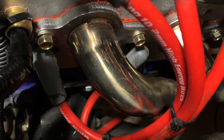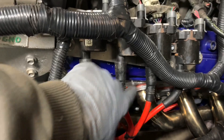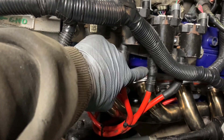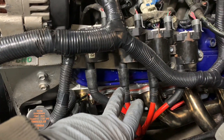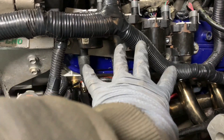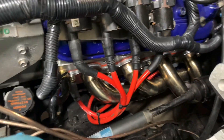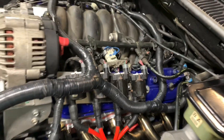Got the spark plug wires on and onto the spark plugs — as you can see, it's out of the way. I got them grouped together. You'll have four straight spark plug wires with straight boots — two in the middle on each side — and then two curved boots facing inwards so all four wires come to a close group. Then I can put a zip tie there, which is farther away than it looks. It's not going to get melted — I've already driven the car like this, and it turned out pretty good.